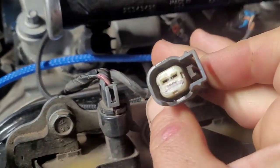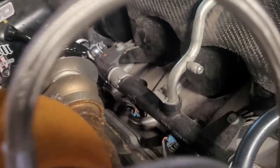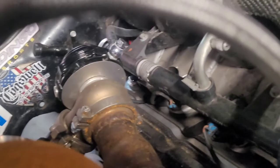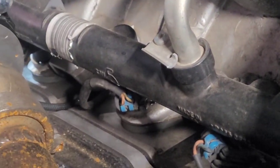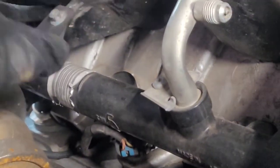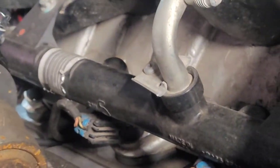This guy is mad that it was that easy and I didn't figure it out right away. If they are hard to access, like you'll see that this one has the forks kind of underneath the fuel rail — it's twisted a little bit — you literally can just reach in there and twist them. So it's super easy to get access to the fork, you just twist the actual injector itself.